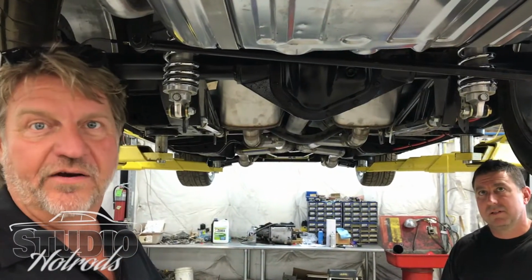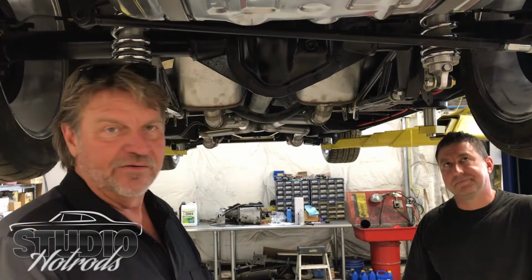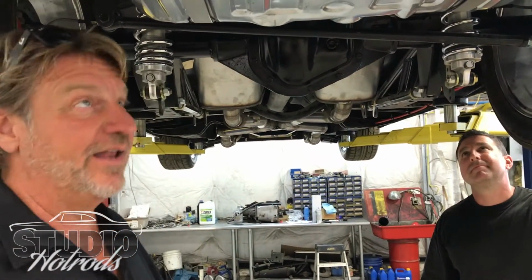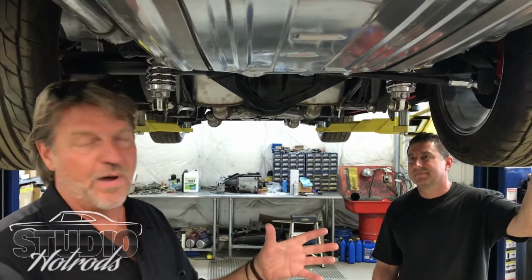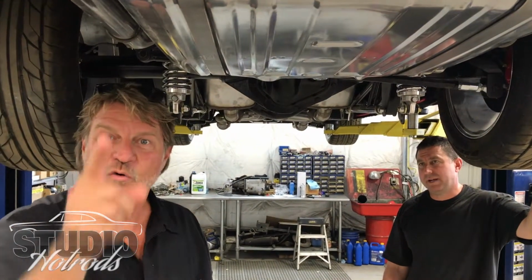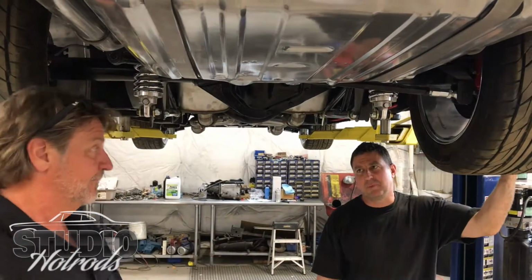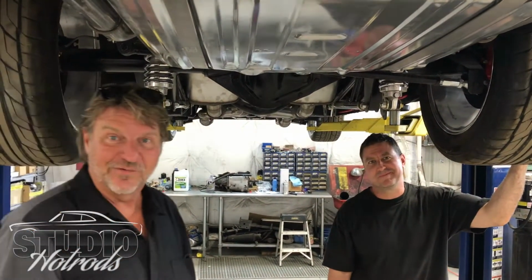Okay, so newer cars have to have high pressure. What is the pressure on it? 60 psi. So you've got 60 psi in the fuel system, right? And the newer cars all mount the fuel pump, the delivery pump, in the tank to keep it cool. Is that correct? Yep. So don't run your cars low on fuel. You know why? The fuel pump gets cooled by the fuel. Right, so it runs hot.